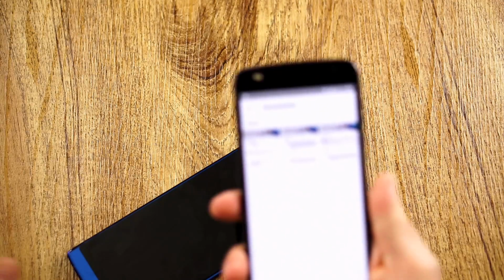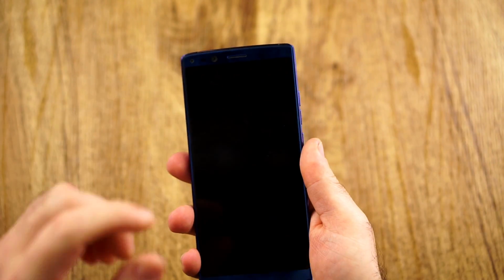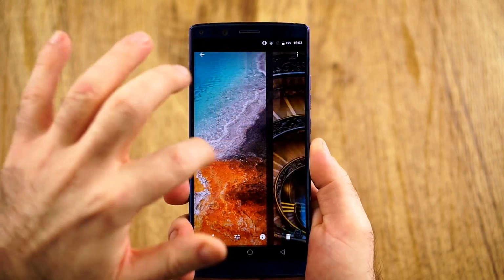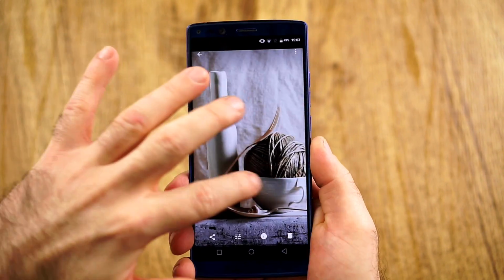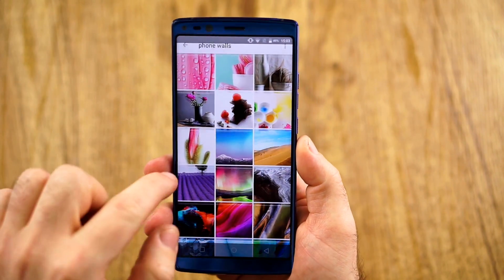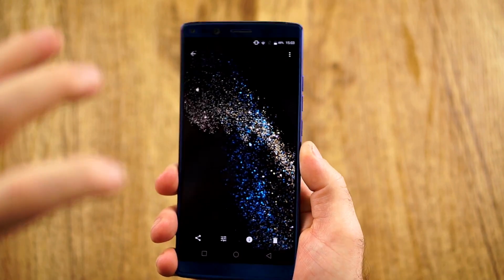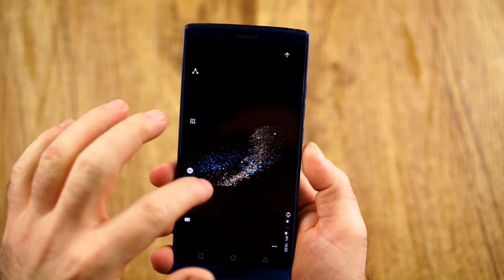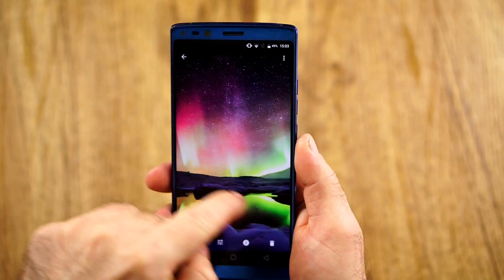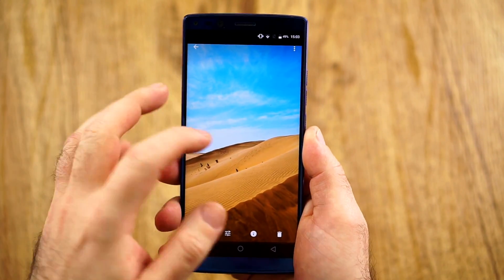Now something else was said, because maybe sometime in the past it was announced as an AMOLED, but it's just wrong. And as a reviewer, all he would have had to do is go to something black, do it on angle, and then he would have seen the IPS glow. And even though I have to say the IPS glow on this device is actually really good, and the way my camera is set up right now, you can't really even see it. But IPS glow just shows it's an IPS display, and it has IPS glow. There are no pitch blacks, not off angle.